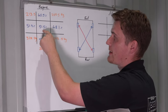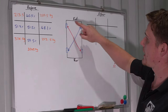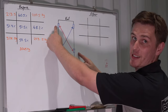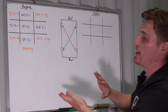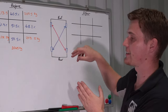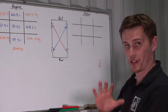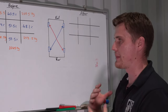Cross weight is best described with this diagram. We've got front-left, front-right, rear-left, and rear-right. The cross weight is the front-left plus the rear-right divided by the front-right plus the rear-left - the diagonal masses of the car - and we want this number as close to 50 as possible. When it is 50, the diagonal masses equal each other out exactly. This means the car will behave the same through a left and right hand corner, whereas if it were very different the car would feel unpredictable - different through left corners than right corners.